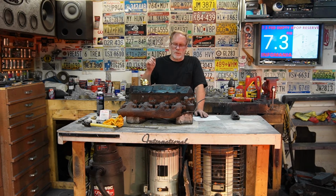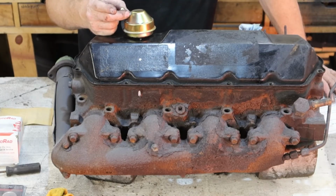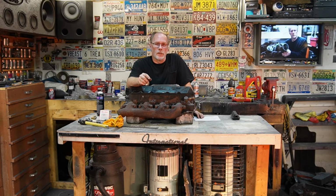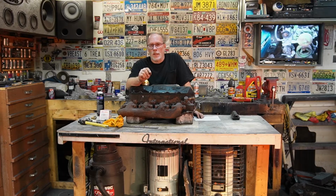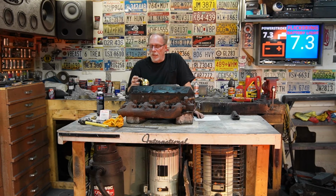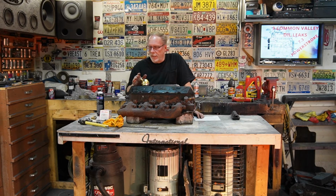And then the type of tubing that I use is, I go down to whether it's O'Reilly's or AutoZone, those are the two most respected, and I get an internal 5/8 inner diameter hose. Now that hose is specifically for emission systems. They might kind of look at you a bit strange, but have them look it up, and it is for emission systems. That way it doesn't catch on fire. An oil hose, a rated oil hose, basically does the same thing. So that's what I connect from here, and that's what I head off to the back.